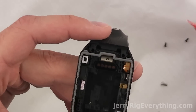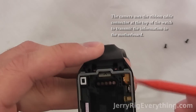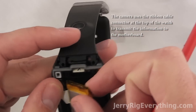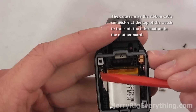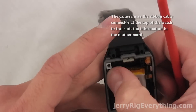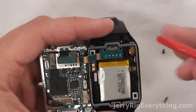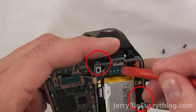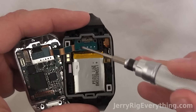Now that that's up and off, you can see inside the frame — this is the little rubber seal that helps keep water and moisture out. Go ahead and place the battery back in starting with the leads, the little connectors. There's a little circular thing on top that helps line up the connectors and have it sit right in the groove where it's supposed to be. Press both of those back down into place, then put the motherboard back in as well. Get it all lined up, and you can see on the top and the bottom there are two sound channels where the microphones are — because you can have a conversation completely from the watch. There's a speaker and a microphone.